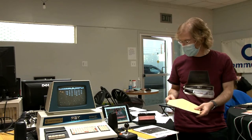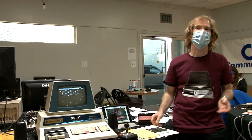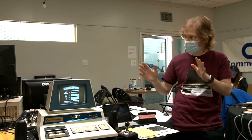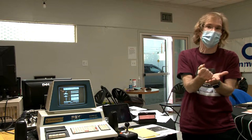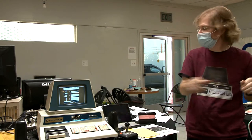The user group decided to use the user port for things the PET didn't come with. The CB2 line was chosen for sound — you can do a sinusoidal oscillator output to that line. They also decided to do the joystick there too. You can even have two joysticks, though no games use two — only one or two games make the effort. Most commercial games chose a specific pin out for left, right, up, down on the user port.